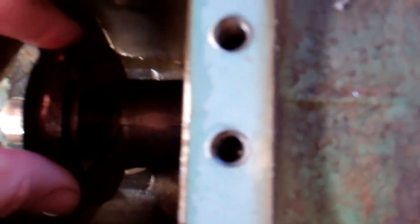That rod there seems quite tight. This one here has quite a bit of movement on it. It's got quite a bit of twist on it as well, whereas this one, even when it's at the top, you can't really move it much at all, whereas this one is even worse down there. So I think that is what's been making all the noise — that back there and there.